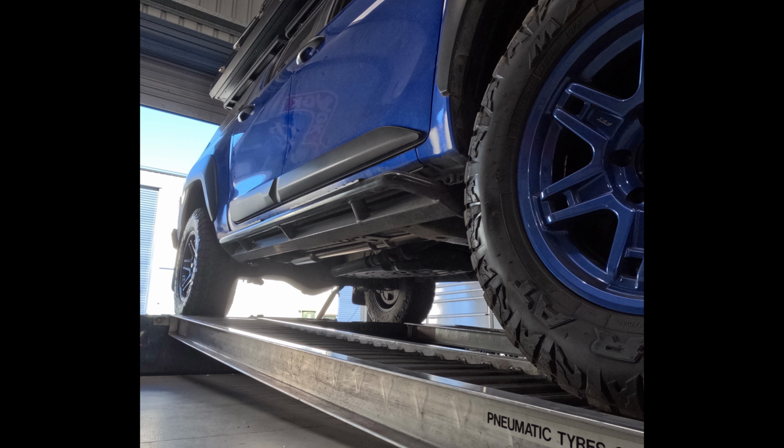A couple of the other tests that we did in the car: Toyota have on the console there a power button and an eco button. Now the eco button restricts the driving and it's supposed to make it a little bit more economical to drive, whereas the power does totally the opposite. But on the graph, when we pushed either, they showed basically as starting off the same, but the power mode did kick in, and as you'll see on that graph, it did give us a little bit more. There was 25.45 pounds of boost all the way through. That didn't change.